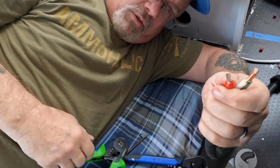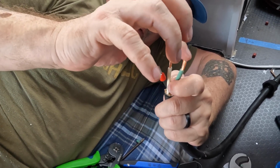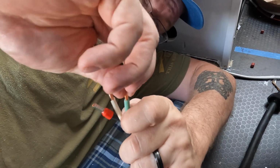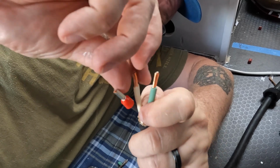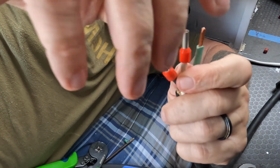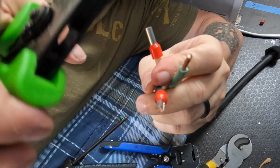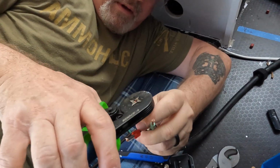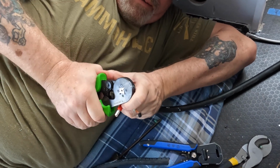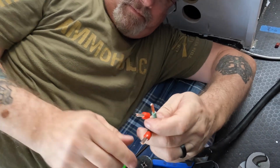It squishes that. The reason you use these is that the wires are stranded, and you can get these little flyers. And if you have one of those sticking out, when you put all this together, it can reach over to the other connection and cause a short. Oh, so you use these ferrules. Plus the square fit's so nice. And it gives the screw something better to bite onto, and you eliminate the chances of spark arcing and shorting them up.